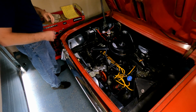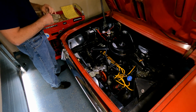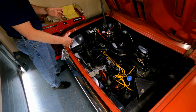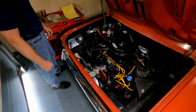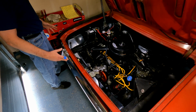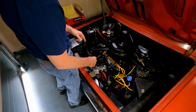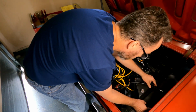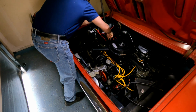I wonder if that's just a valve that's misadjusted or something like that. Seems like I can lose compression. I don't know, but the rings could be allowing air through, or maybe a valve that doesn't quite seal shut. I did do a valve adjustment last year. Maybe one of them's too tight or too loose. I'm not sure which way would make that happen, but that is definitely not good. And I definitely had a running issue, and that could be the source of it right there.